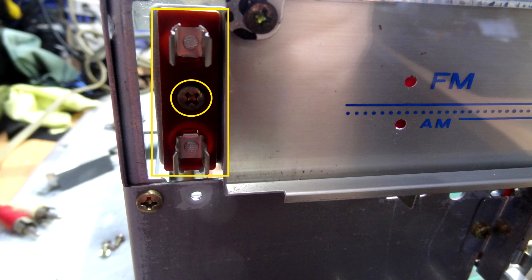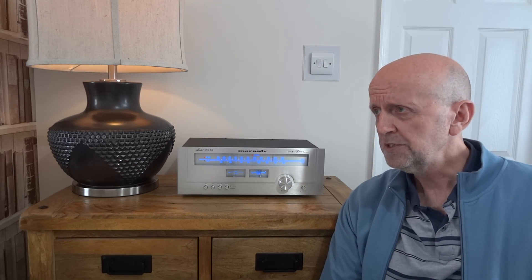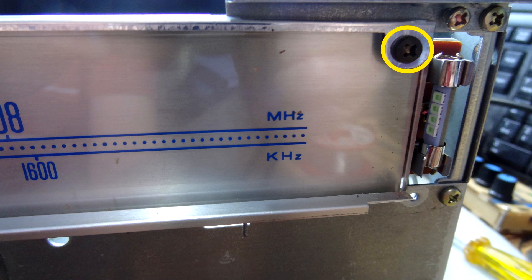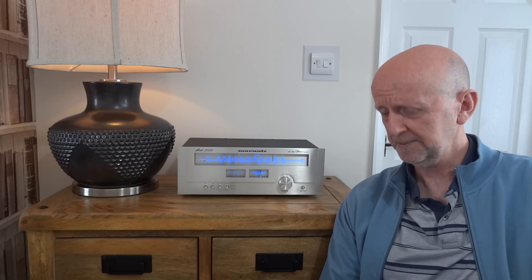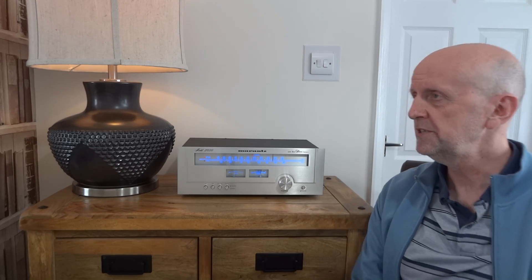Then you have to undo this screw holding the light bulb fitting in and remove it — just the one end, the left-hand side. Once it's taken out, undo these three screws and one screw at the other end, and now that panel with the plastic front cover just slides completely out. Give it a clean, replace it, push it back in, and re-solder those two wires back and reassemble.